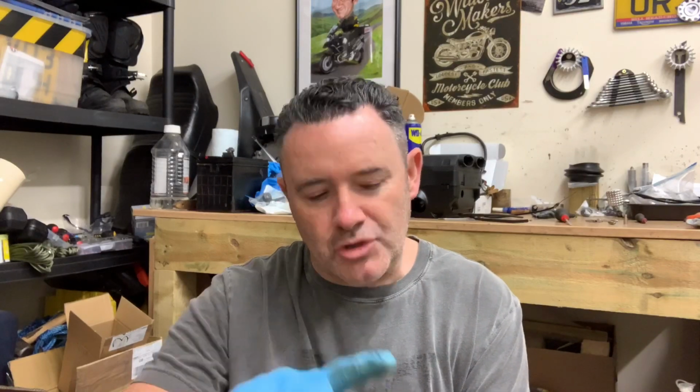Well, there we are for another week. Thanks for watching. I hope you enjoyed it. Just a reminder, that throttle cable assembly is a temporary one. I will cut to length, I'll route it properly, I'll solder the ends, all that good stuff. This is just so I can rev it when I get a spark to it, which is the next task actually. So fuel and a spark, and we'll try and get the engine going next time.